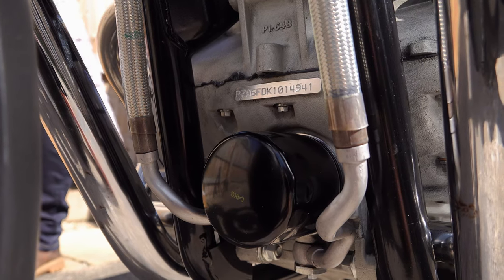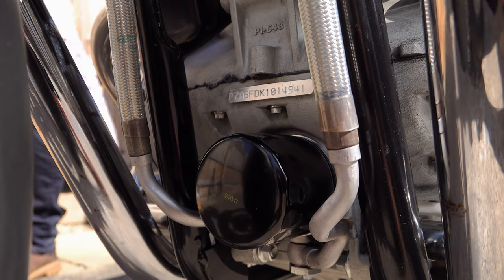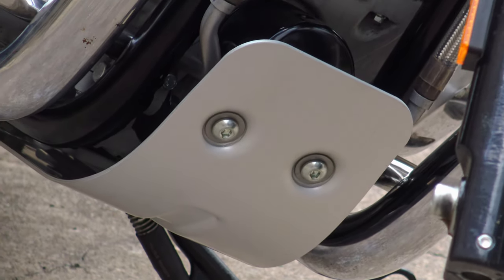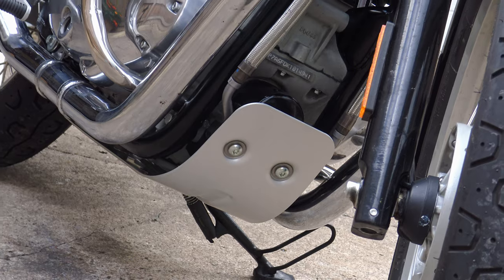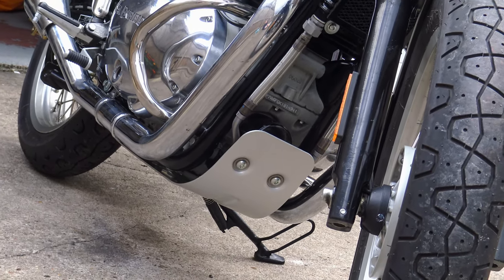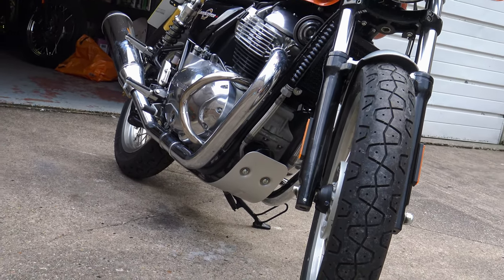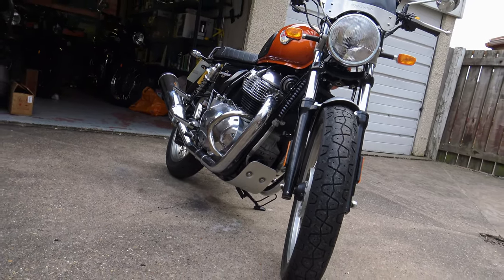The metal used in these oil filters is very thin, and due to its position at the front of the bike it's very vulnerable if left unprotected. There will undoubtedly be incidents of punctured oil filters. This sump guard is the perfect fix — it gives more than adequate protection from stone chips kicked up by the front wheel. Royal Enfield haven't fallen into the trap of putting decorative holes in the front, which would negate the protection. As far as I'm concerned, the Royal Enfield sump guard represents the best on the market for the Interceptor as it stands.